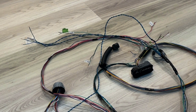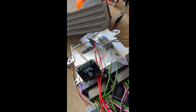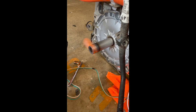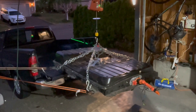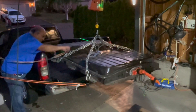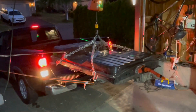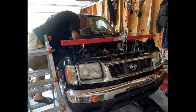The Resolve controller uses the original Nissan Leaf wiring harness, so you want to make sure you get that with your motor. Isaac, the owner of resolveEV, provides detailed instructions on how to wire up the controller, and after a lot of tinkering and help from the online EV community, I was able to get the motor spinning on my test bed. The total so far for the components is $3,445. I searched Craigslist and Facebook for scrap metal for my adapter plate, wire, and other miscellaneous parts — I'm sure it still keeps my price under my $4,000 budget.